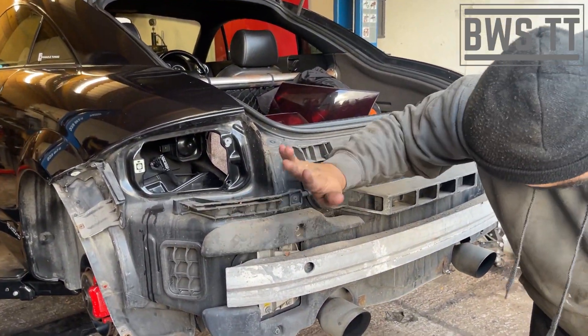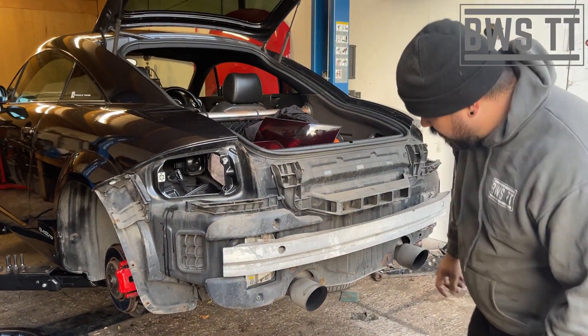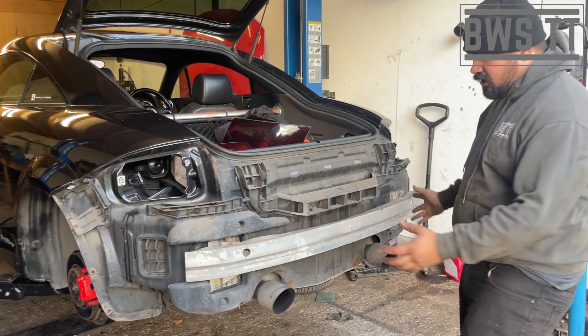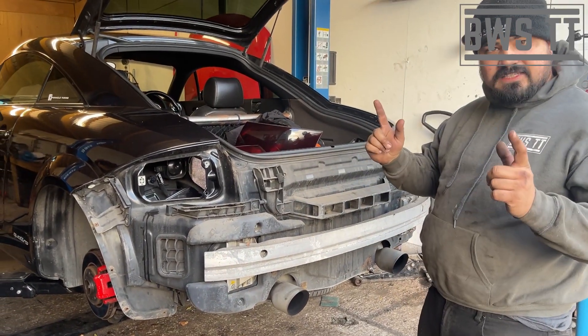This is the harmonic damper — look at the size of it. Solid cast metal. Completely pointless. So we're going to undo the 13mm bolts that are holding the crash bar on both sides, pull that off, and then we can whip all this off. Let's get to it.